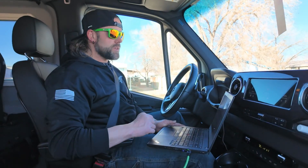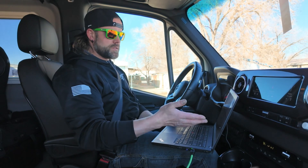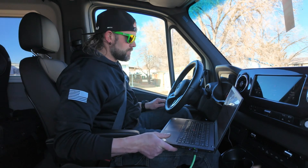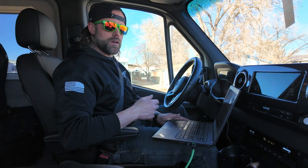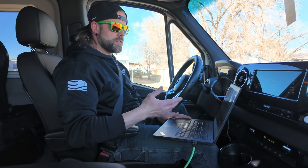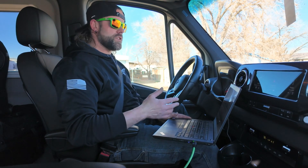The calibration drive is over. We get a 'successfully ended' readout on the computer, so the next step is to simply cycle the ignition, scan and clear all the codes, and then you're good to go. After that you'll be able to engage your cruise control and drive the vehicle like normal — very straightforward procedure assuming you have the proper equipment.